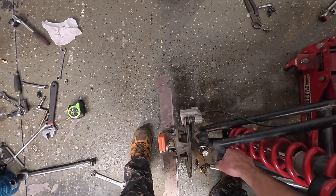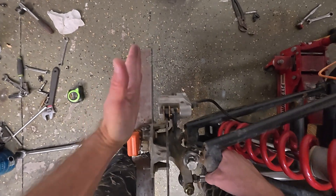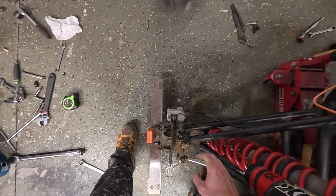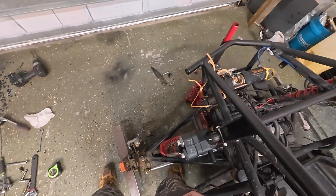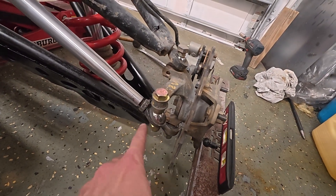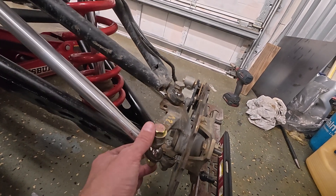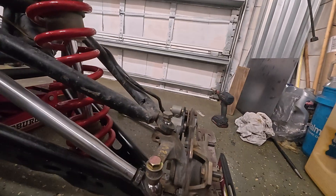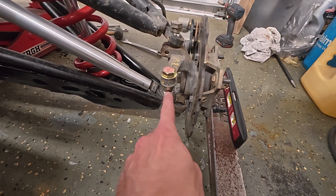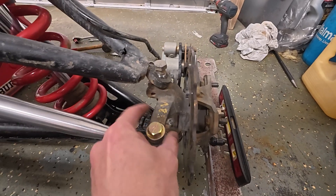A few moments later — we're at zero. And as I raise up the suspension, we neither toe in nor toe out. And that is how you remove bump steer the correct way. Now I don't have to worry about these bolts bending, and if they do bend a little, I can just replace them. You can see they're fairly short — I don't think we could put enough leverage on that to actually bend that bolt. To bend it at this angle, we'd probably be closer to snapping the arm than bending the bolt. As always, I'm Rick with Dirt Gear TV. Thanks for watching — I'll see you guys in the next one.